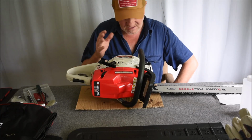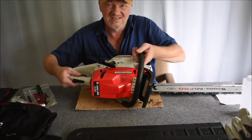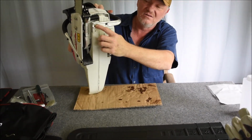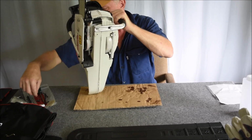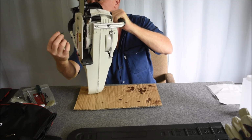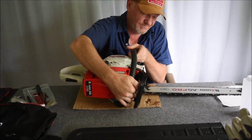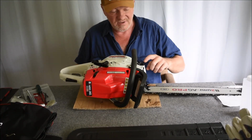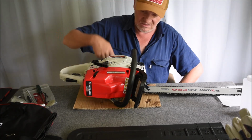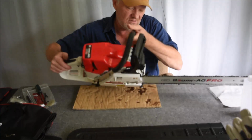Go over all the screws, because they won't all be tight, and they weren't, or sometimes if you're really unlucky, they won't always be there. Okay, so this thing here, that is a tech screw, a short tech screw like that, because these plastic screws or whatever, they're a socket screw. It was just spinning around there because whoever assembled it just cross-threaded it, because let's face it, people aren't doing it by hand. They're probably getting paid by the piece, so they're using electric tools, and when you're going into plastic, it's really easy to cross-thread, and probably the same thing happened with that screw.